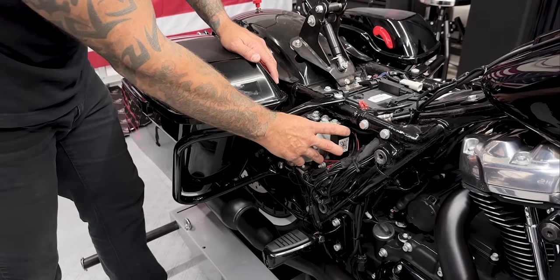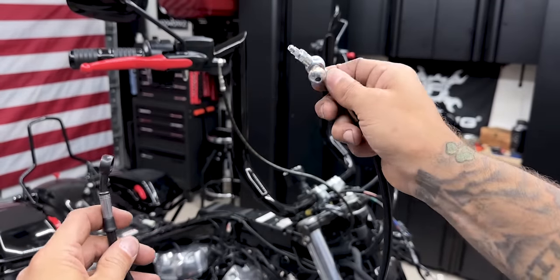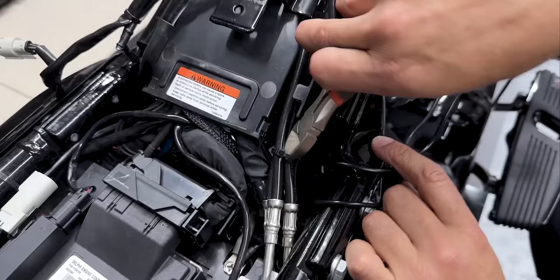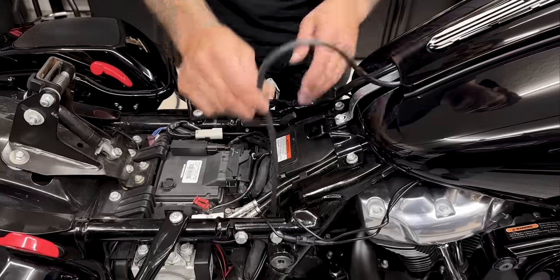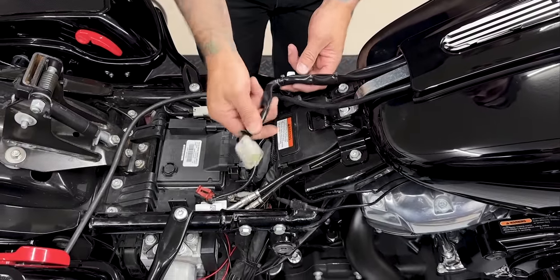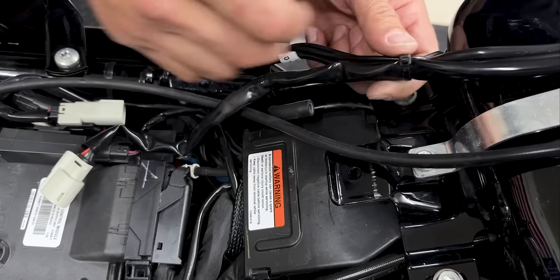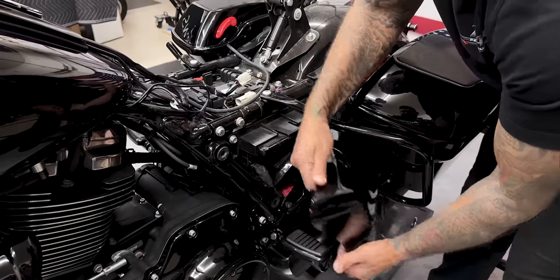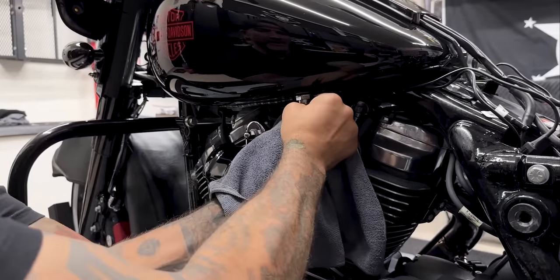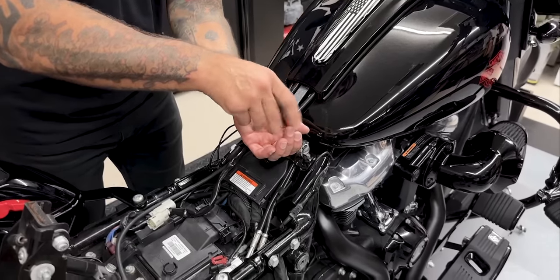Here you have the ABS system. You don't have to worry about going to the dealership to get it reset — the brake line extension that Fat Baggers offers makes it simple to connect everything at the front, bleed it, and you won't have to mess with your ABS. He has some aftermarket lighting, so I'll cut the zip ties secured to the fuel tank connector, get the screws out in the back and front, and get the tank off. Disconnect the fuel line by pushing up on this collar and it pops right out — have a rag ready to catch any fuel. The two screws in the back of the tank are a half inch.